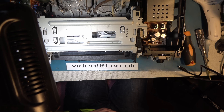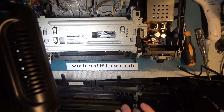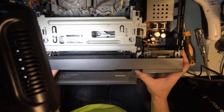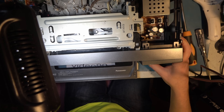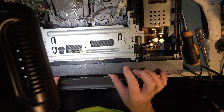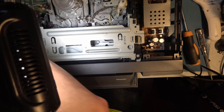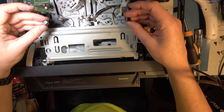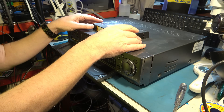When refitting the front panel, it's extremely important that you open the cassette door before you slide the front of the machine back on, otherwise it won't engage properly with the front door opener. During final reassembly there are some rubber pads here that keep falling off — I believe they're supposed to be there so I'll use glue to hold them in place. Okay, let's do a final test.